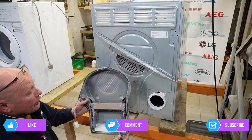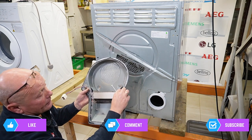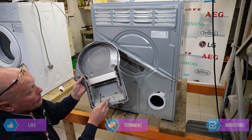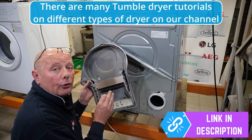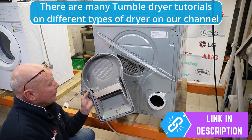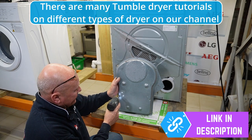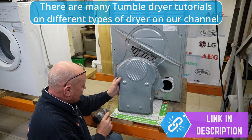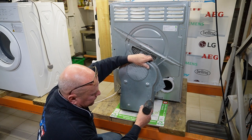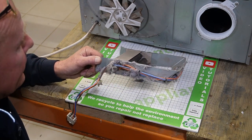You can see here there is still quite a bit of fluff built up on the heater unit. This is what could cause the fire because this gets up to three or four hundred degrees while the air is flowing through. And there are two thermostats on the bottom. There are other videos on the website to show you how to test heating elements, and when the new heating element comes I will do a video on that as well. But I'm quickly going to remove this and test it for you. There are two screws that hold the heating element in place — carefully remove these and keep them safe because they are totally different to any screw that's on the dryer at all.